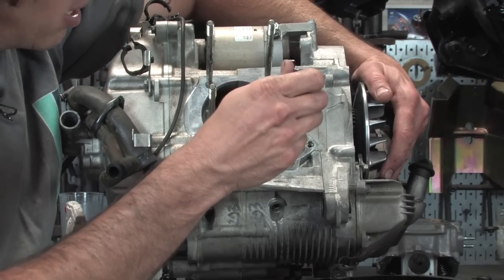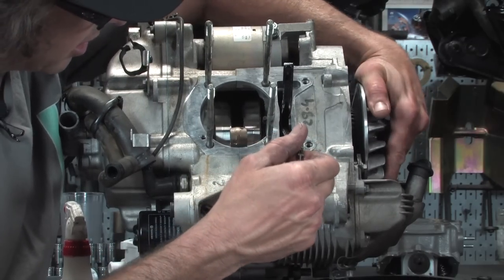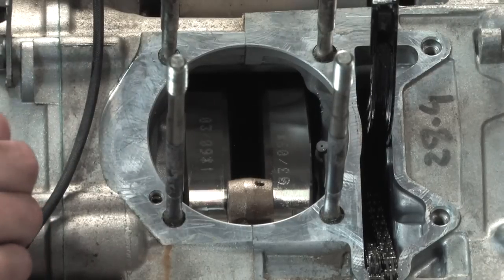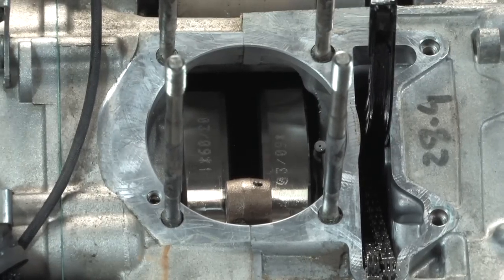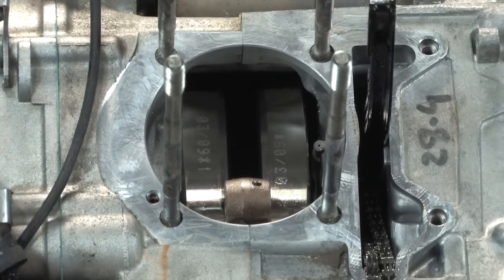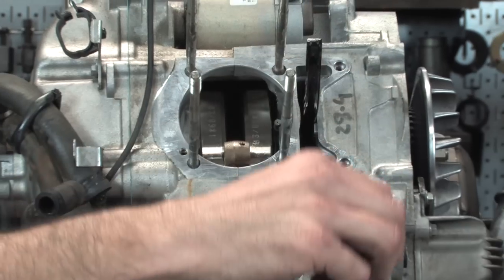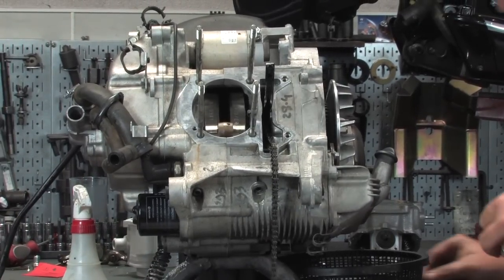So the way to check is you go to bottom dead center on the crankshaft. Move your hand down if you can. We're going to crank the engine over, and you're going to see some engraved numbers at the very bottom. I'm not all the way there, but basically I see 03/09*1. That basically means it was made in March 2009. The star one is the actual crank category. It's a category one crank, and it says the same thing on the other web, star one. If it was a category two crank, it would have star two. Those first numbers are just a date code for when the crankshaft was manufactured. So if I was replacing this crank, I'd put in a category one, even though this engine case says two and one. One, two, crazy. And if I wanted to take it further, I'd measure the actual journals for the main bearings in there.